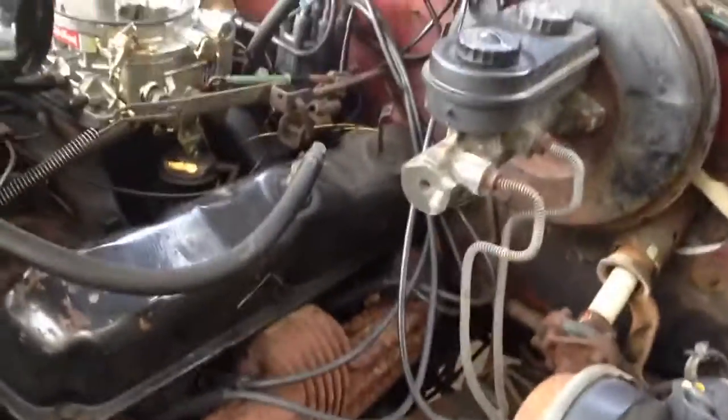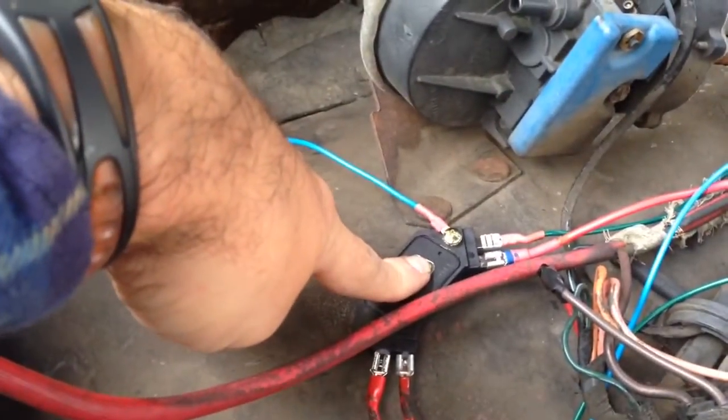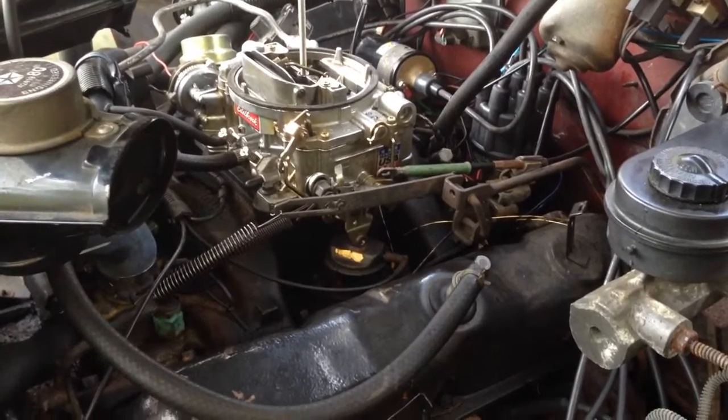Got sick and tired of dealing with the pesky Dodge ECU and some other ignition problems, so I decided to do the GM HEI module upgrade with a new coil. I used the TP45 for the GM HEI module — about $40 from Napa — and then the IC27 coil was roughly the same, so it was like $70 to do the whole thing.